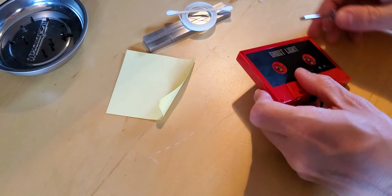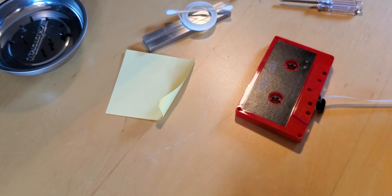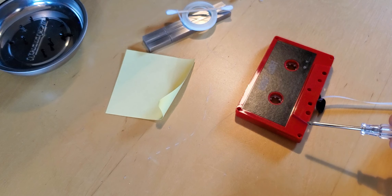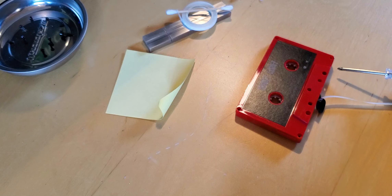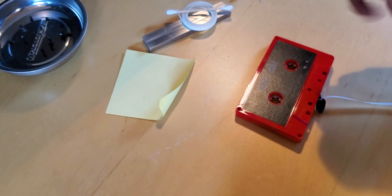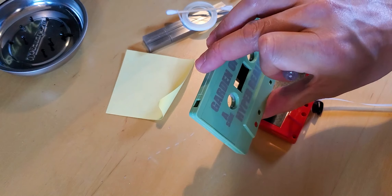Something to keep in mind: the cassette is going to be in two parts. Think of it like a book — the screw side is the front cover, so you want to open it from that side, either to your left or your right. Inside, there's going to be a bunch of little pieces, and ideally you don't want them scattered everywhere. There are going to be rollers, and those rollers are on a pin that's only on one side of the shell. You want to have the side with the pin flat down — that's the non-screw side on a five-screw shell design.